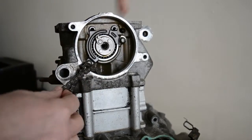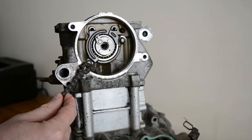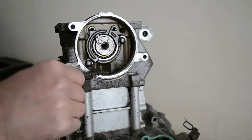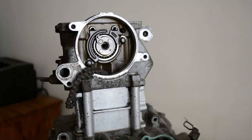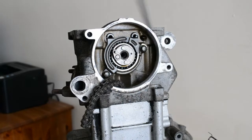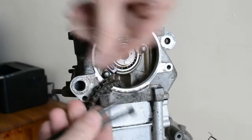Just keep the tension on the chain — if it falls down it will come off the bottom timing gear and get lost in the bottom end, so you don't really want to drop it. Keep it tight, and then we're going to take the head off. We've already pulled these two Allen key bolts out.